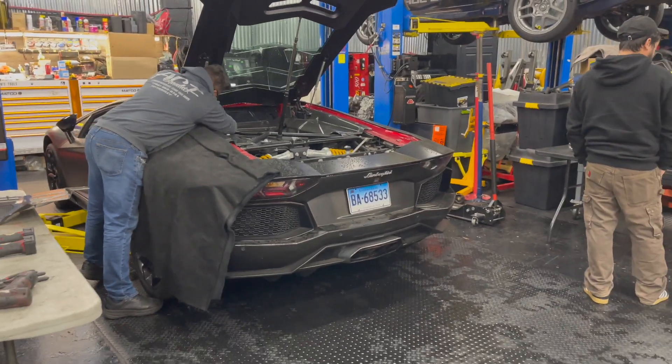I don't really like engine mounts — I like the factory ones because the car vibrates a lot with solid mounts. If I had a track car, I'd do it. APR software developers actually had a problem where these solid engine mounts would cause a lot of feedback knock. The knock sensors would go off and you'd think the car was knocking, but everything was so solid. They took them off, put the stock mounts in, and everything was fine. They had to literally recalibrate their tunes just for the mounts.